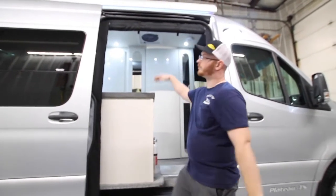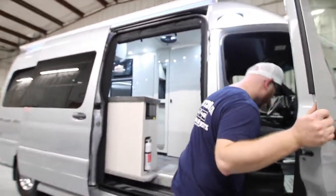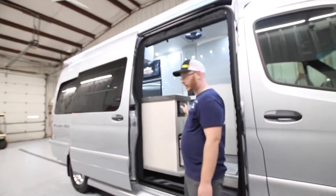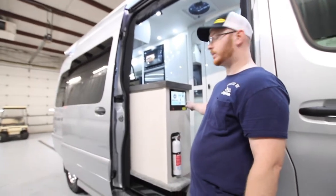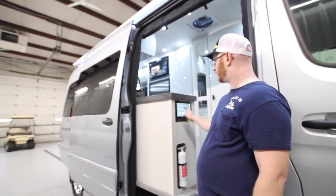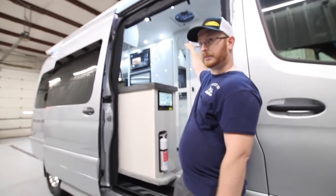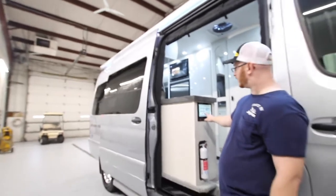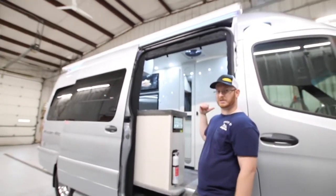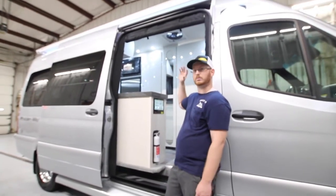We have a full-length awning, which is our Eagle — this one's a 35. This will be controlled from our main control panel at our entry door. Push the gears — that will give us our bed, our awning, and our fan control, which is in the center by the bathroom and over the galley area. If the ignition disabled light is on, it means when you have the key on or the coach running, it will not allow operation of the awning so it doesn't move out while in transit. You must have your coach completely off, then pull extend for it to go out.